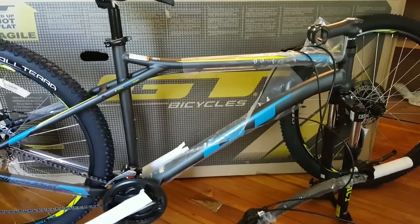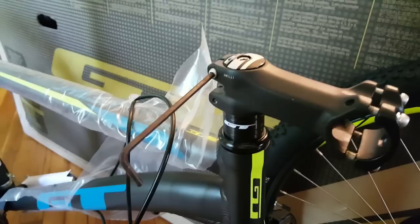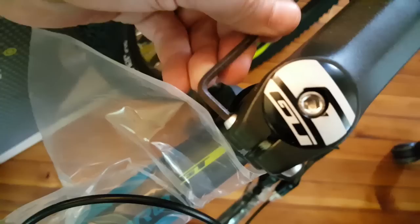I'm going to start with the neck — it's going to be kind of hard with one hand but I'll get going on that. Alright, got our neck switched around — that was easy. The neck bolts here are 4mm, and your stem bolt is a 5mm. Loosen the neck bolts, loosen the stem bolt, turn it around, then tighten the stem first and then the neck bolts. Don't try to move it without untightening them. I'll cinch them down somewhat evenly and go through for final adjustments after.